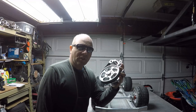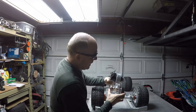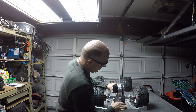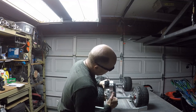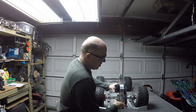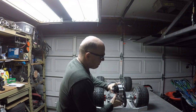Today we install the drive unit on the mini model S. This drive unit will be mounted at the center of the axle. I want it centered rather than offset to the side — even though the sprocket is offset — for symmetry, weight distribution, and because the curve of the body allows more room underneath for the drive unit to reside.